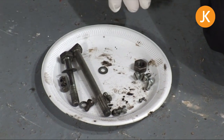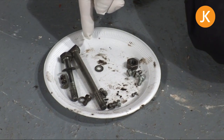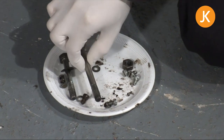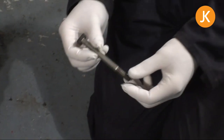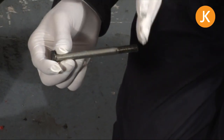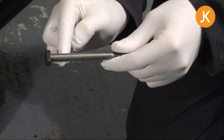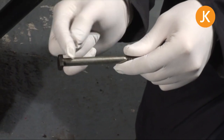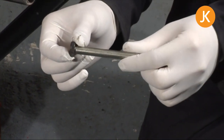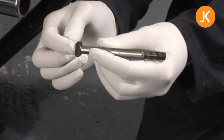You can see here the tray — I couldn't find my magnetic one so we've just got a plastic tray which I put all the bits in when we took it out. The two lower nuts we've already fitted, but I want to show you the D-bolt here. This is the one that also retains the starter motor, and it's that awkward one that we get to from behind the fan housing. Now a little trick: these are quite loose in the top of the bell housing, so I put a little bit of insulating tape — electrical tape — around the top, just a couple of wraps. Remember it's got a flat portion so you have to put it in the right orientation.